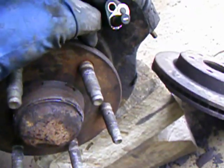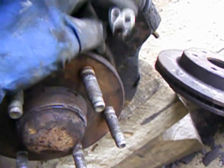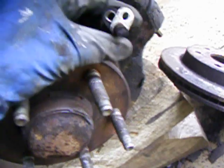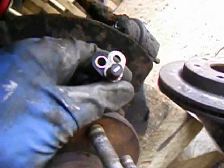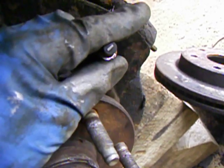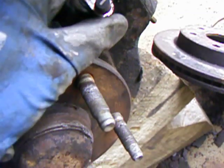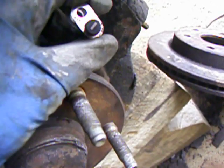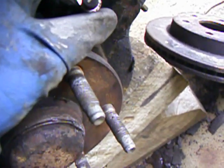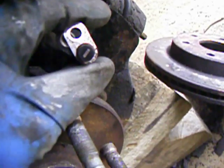I don't know what the spec is, but I'm sure that they're fine. One thing I forgot to mention in the other video: when I took this off, you'll notice there's a little metal thing right in the very center of the sensor. That might have some crud built up on it — you want to make sure that's really clean. If there's any rust or metal debris that gets on there, it might mess up what the sensor does.